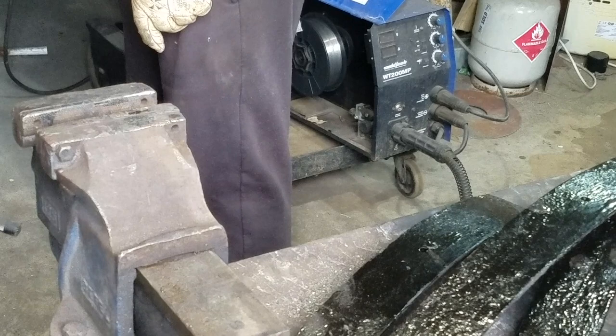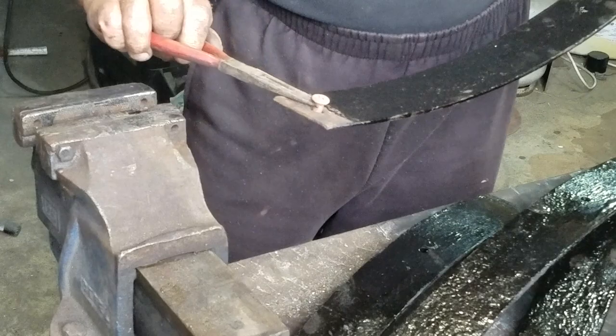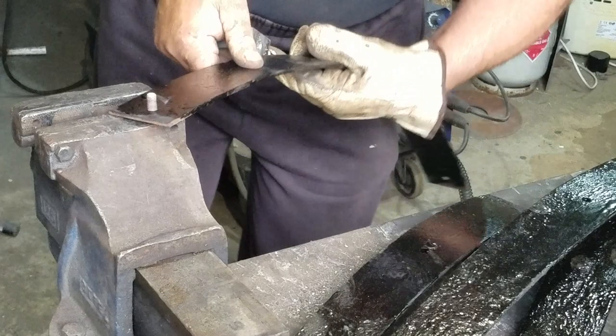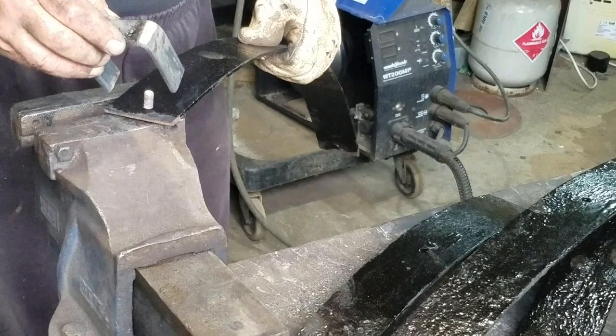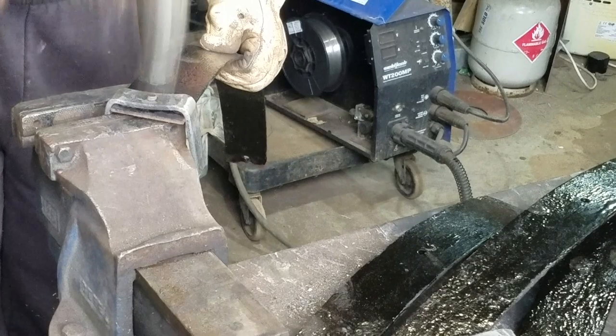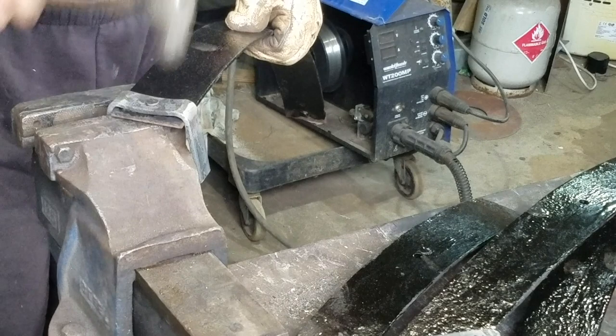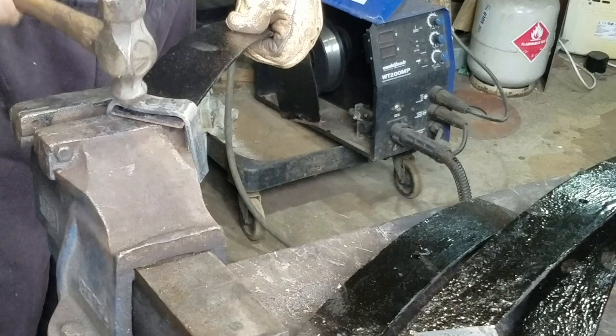Because I've already painted each individual leaf after cleaning it with the Gilsonite chassis paint, we're going to end up with a leaf pack that shouldn't rust like the last one did. I've only painted where the leaves are touching on the inside. Once I've assembled the leaves into a pack and fitted that pack back underneath the Land Rover, then I'll repaint the total outside. I don't want to paint it while handling it because it takes several days for this stuff to dry.